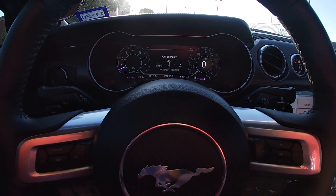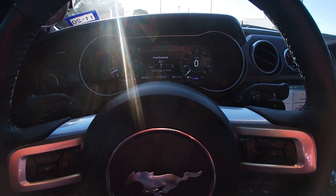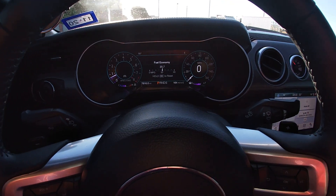The next data log they request is what's called a step rev test. They asked for a step rev test up to 3,000 RPMs — you'll do this in park. You're going to make step revs up to 3,000 RPMs. As you make each step, try to rev and hold it somewhere — I'm going to try probably 1,500, then maybe about 2,250, 2,500, and then 3,000.